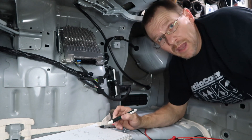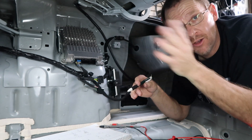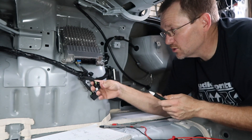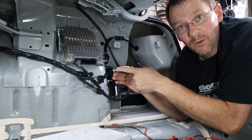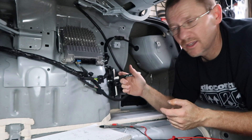On this plug the passenger rear door isn't in sequence with all the other doors. All the other doors go positive-negative, positive-negative — but this door is negative-positive. If you're just assuming that because three of them are all in the right direction the fourth one would be too — don't. It's not. Number four, as we call it, is backwards. That's messed up — what the heck were they thinking?